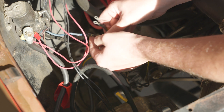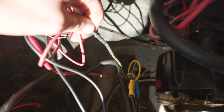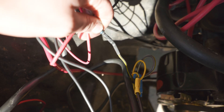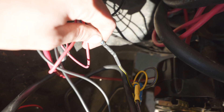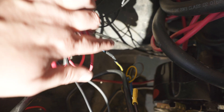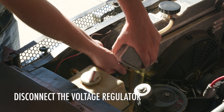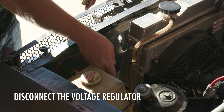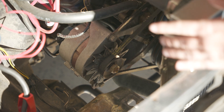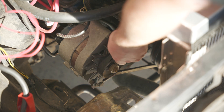This wire had to be hooked up to 12 volts. The wiring harness was pretty hacked up from a previous owner, so I needed to hook it up - this wire was already 12 volts to make everything work. Then we just connect the harness from the voltage regulator. With the wiring harness unplugged and battery removed, we have pretty easy access to the alternator. First we're going to loosen this 9/16 bolt down here, which lets us take off our belt.